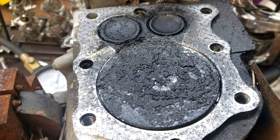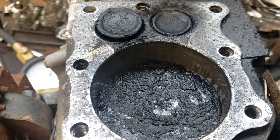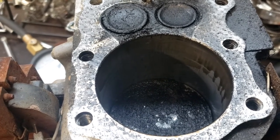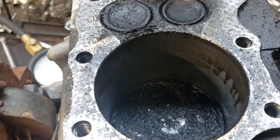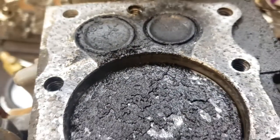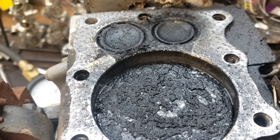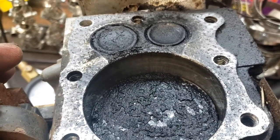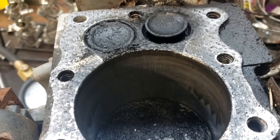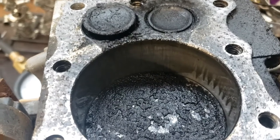I grabbed the engine out of the scrap pile. It's a little easier to show you on one of these flatheads or L-head engines. So we'll start with the intake stroke. The intake valve just opened, and when we get to the bottom of the stroke, the valve will close. Now we'll be getting ready to start the compression stroke. As the piston comes up, you'll see this exhaust valve will slightly open for the compression release right before the piston reaches top dead center. Then you have our power stroke, and this is where you want to set your valve clearance. As we come down on the power stroke, we start to come back up, and the exhaust valve opens for the exhaust stroke. Then it just starts over again. There's the four cycles, where you get a four cycle engine.